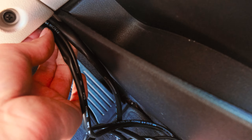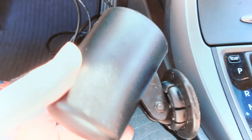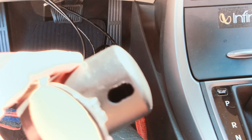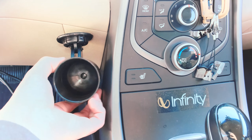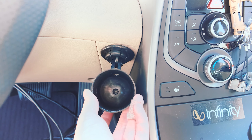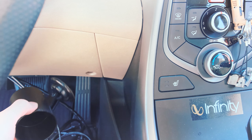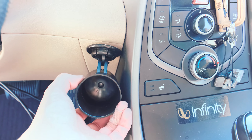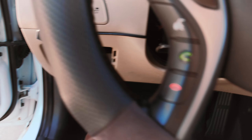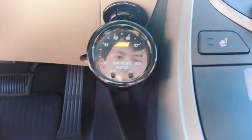We have our slack set up perfectly, started feeding it through the tube, got our pilot hole done — nice and sealed. I'll probably put some silicone grease around there to increase water resistance on the outside. We're going to pull it through, put the grommet back in, pull all the wiring from the front through to the back, zip-tie it up in a bundle nice and tight. Before zip-tying everything we're going to figure out where the gauge pod is going to go, insert the sensor, and see how we want it positioned before we finalize how much slack is underneath. I got all the wiring done, zip-tied underneath, and got the bundles we need. The plan is to run it across and up into the GlowShift 52mm gauge holder — I had to drill a bigger hole since the outlets are squared and bigger than the original circle, so I made a matching circle and tapped it out, put the foam in. The gauge is going to mount right here so it's not always in the way but I can always see it when I need to.